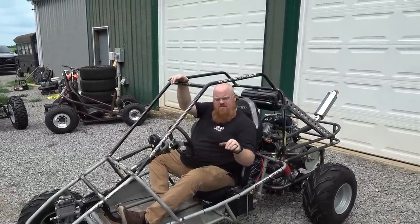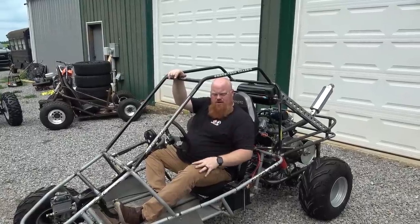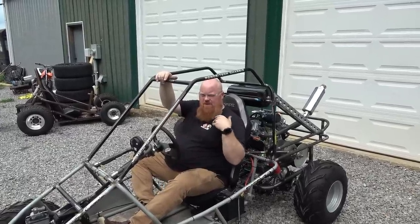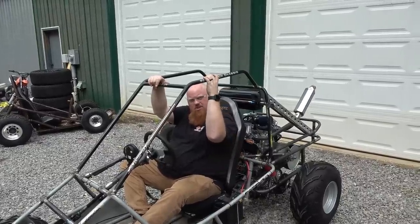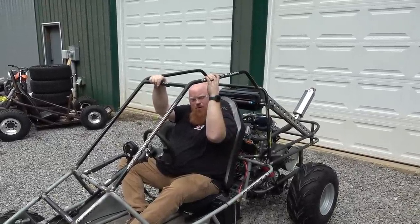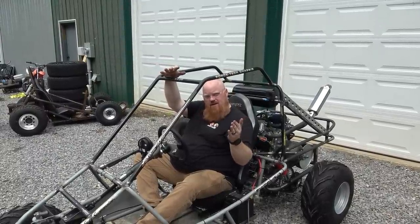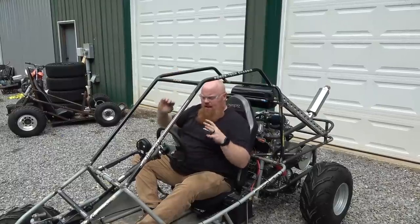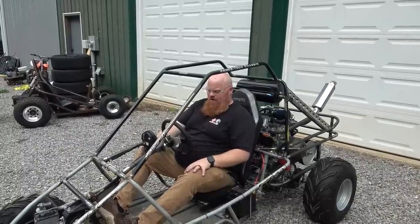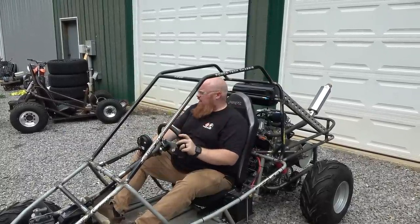So basically 17 and a half to a 20 pilot jet, which is your idle circuit, and we have a, what, 25? 27 and a half. 27 and a half, so we definitely need to dial that back. We're thinking because of the bigger engine, it's not much different than a 670, honestly. You would think it would be, but the carb was factory, same size as a 670 and everything. So we're going to have to dial that down. We're going to be flooding it out a little bit, but let's do a first ride. Got the GoPro on. Our tach is not working because I forgot I have to bypass this box. I'll show you guys on a later video.